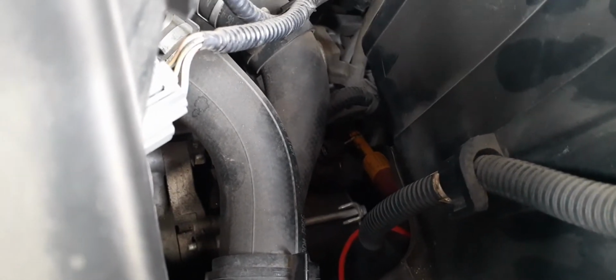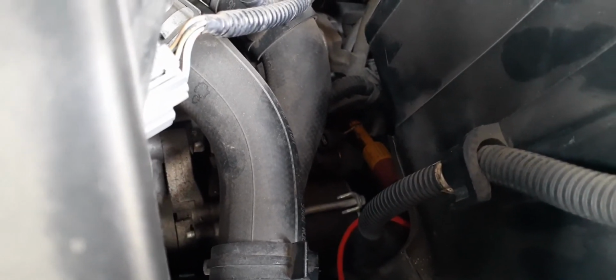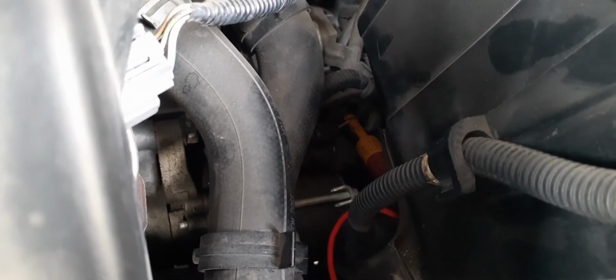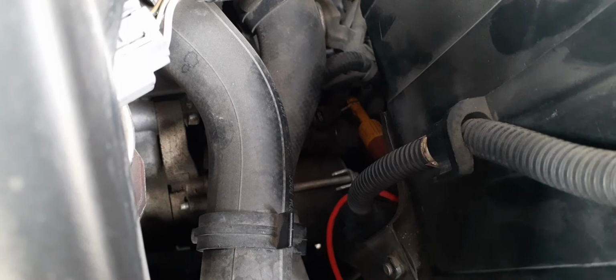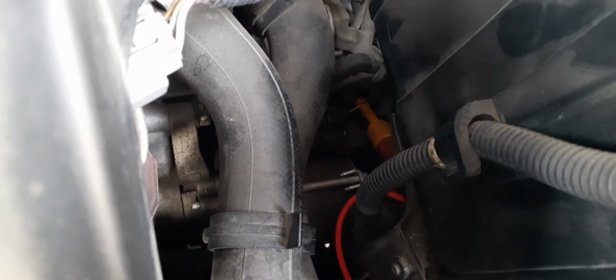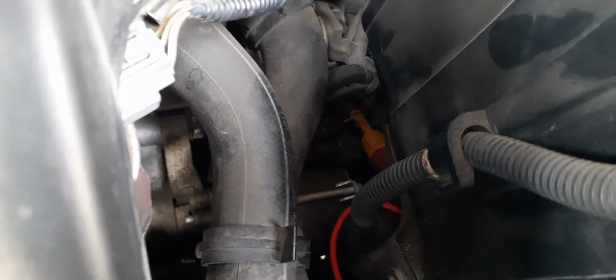I also took off the starter relay, and I'm checking the wire. I'm getting voltage to it. I said, wait, let me disconnect the starter wire, the ignition wire coming down to the solenoid. Took it out, voltage cut out, so there's voltage backtracking from the starter solenoid itself. That's another no crank, no start.